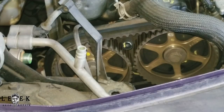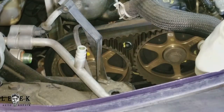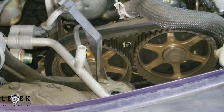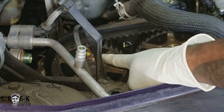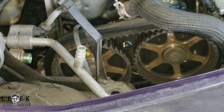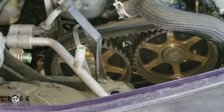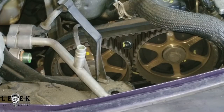I hope the brightness is adequate for you guys. The notch on the sprocket is right there, and there's another one on the cam itself — those two are going to line up in the center. I also want to get the crankshaft lined up at the bottom. I'm hooking up a half-inch ratchet with a 19 millimeter socket and doubled-up extensions. I'm going to rotate things clockwise.